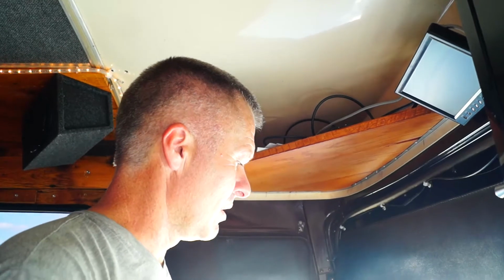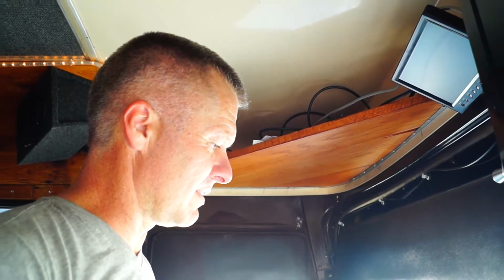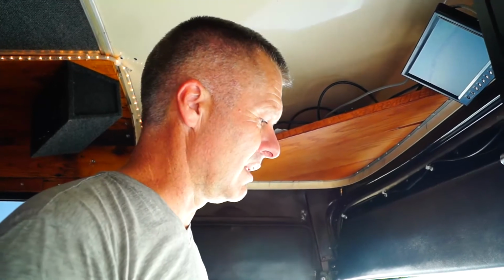On an old bus, you more pay attention to just what your oil consumption is, and if it has a lot of blow-by. That's one thing I did not mention. At the end of this video, we're going to go back and start it up and let you hear the engine run, and I will pull the oil filler cap off. You will see, surprisingly, it shows really no blow-by with this engine at all. That's very odd for an old diesel, but anyway, I think it's in fairly decent shape.